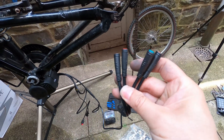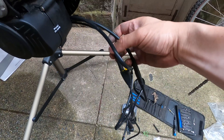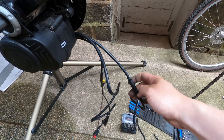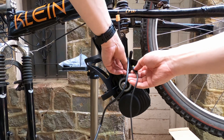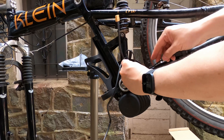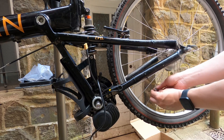Taking a closer look at the motor, you will notice three main cables. Connect this bundle to this cable — it is for controlling the motor. The slimmest cable is for the speed sensor, and the last cable goes to the battery. It is not possible to connect cables to their wrong counterpart — you basically connect squares to squares and circles to circles, and some are even color-coded. The speed sensor is supposed to wrap around the tube and secure via zip tie, but my tube is way too big. I ended up removing the plastic piece — there is only one screw holding this plastic tube adapter. I secured the sensor with three zip ties.